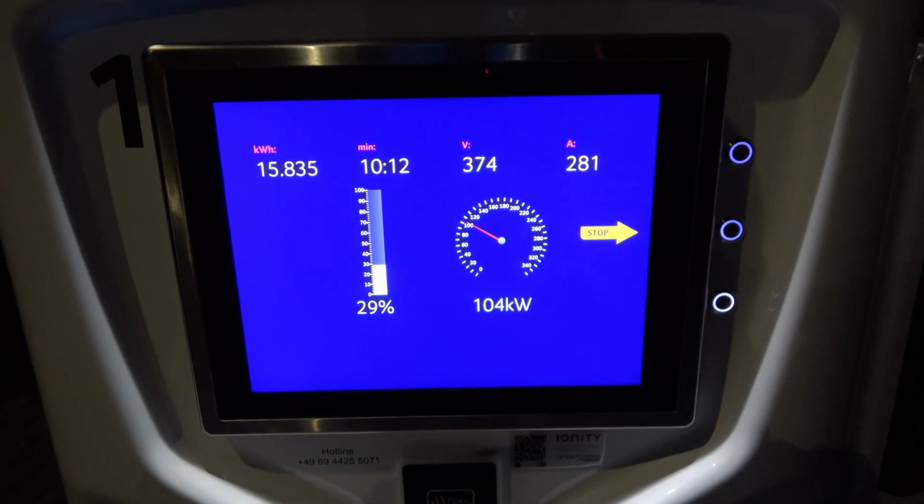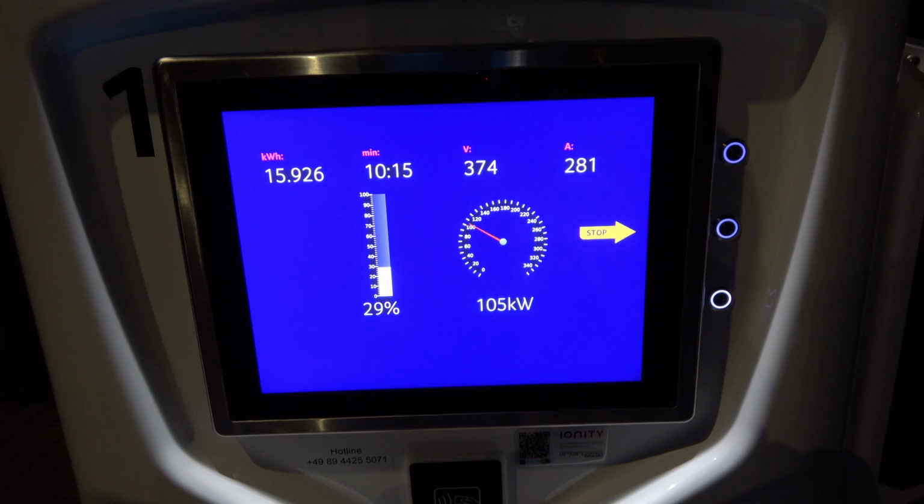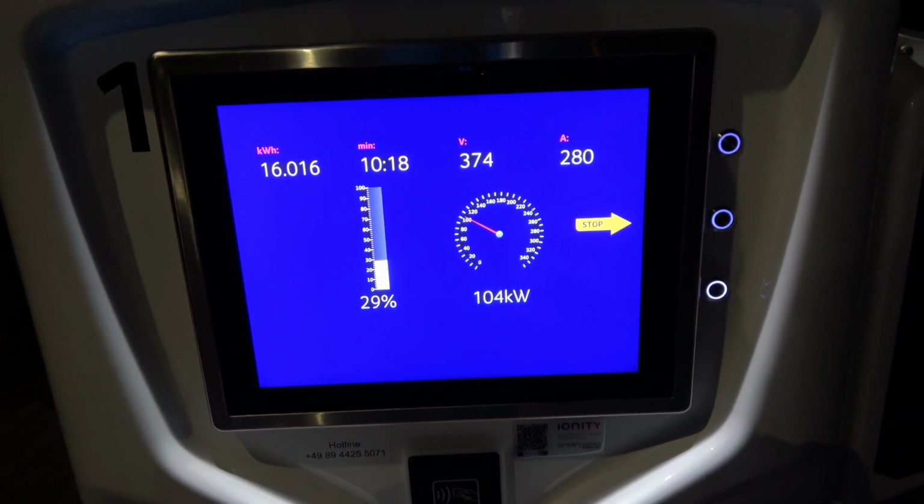But when they installed it, it wasn't working. The first time I tested it, it required a new software update, installed the update, went out to a supercharger to actually test it. It didn't work, and apparently I had to come in to do a manual reset of that little box device that they install because something was wrong with that. But after they installed it, the CCS charger has worked, and I tested it at Ionity, and also it doesn't change anything to your charge speed because it's the battery that is limited. It's not the type 2 charging or the supercharging that is being limited, and it would be different with CCS. Nope, it's your car that is being limited.